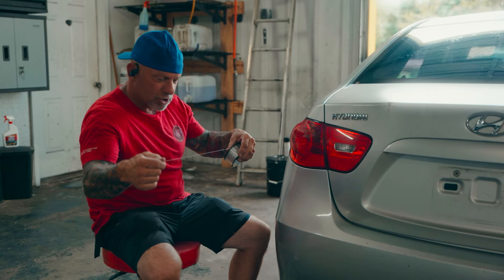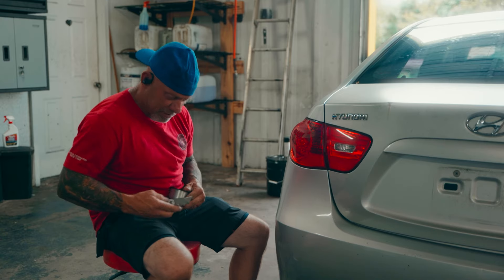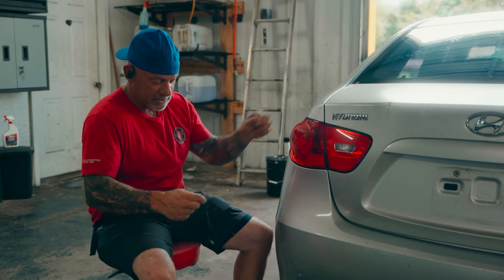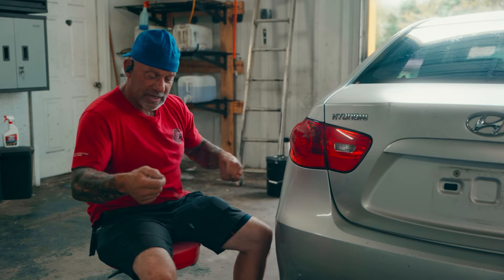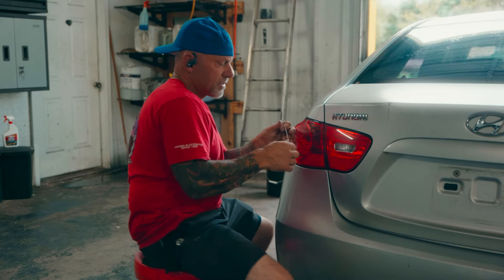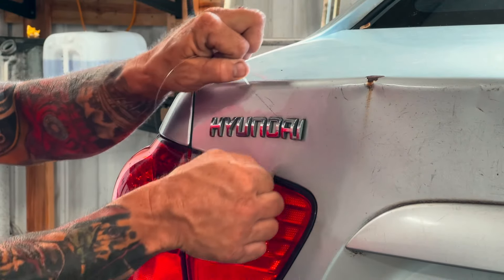What you want to do is get a good piece of fishing line pulled out that you can use. Cut you a piece of fishing line, then you want to get this piece kind of like you do dental floss. This is going to help you saw or remove in between the glue and the metal and your badge, whatever it may be. Then you want to get it in behind it, just go to pulling in between the lettering and the letters.